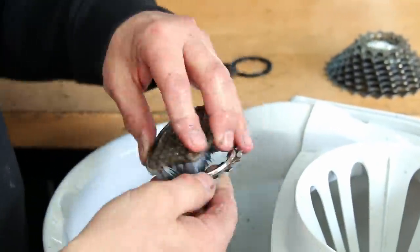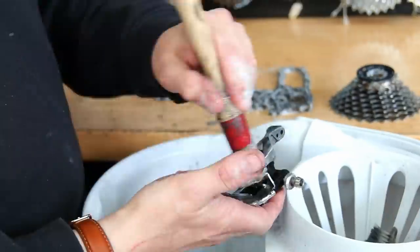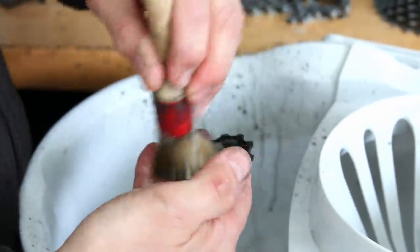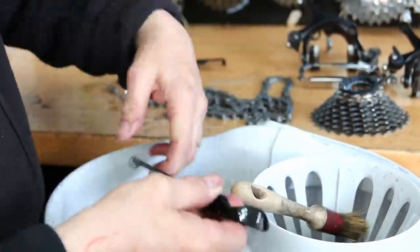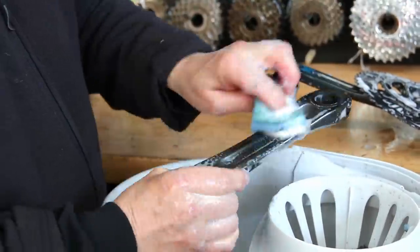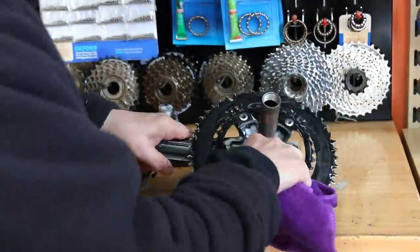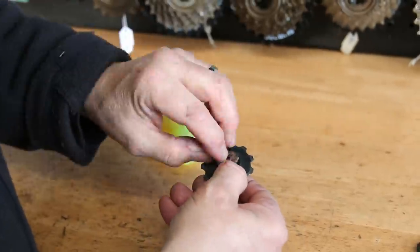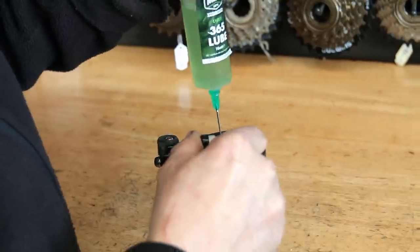While I'm cleaning up these parts — myself and Simon, my son who films all these videos — we're thrilled with the way the YouTube channel's going. If this is the first video you're watching, this is the kind of thing we do each week: we service a customer's bike on film in a practical manner, just as we do day in day out. Do subscribe and like the video, and comment early, as that helps the algorithms. Now we're just re-lubricating parts that have been cleaned — oiling them, using copper slip, using thin grease on pivot points, even a little silicon grease where the slider of that spring goes up and down on the caliper itself. There were three or four greases used just on that brake caliper.